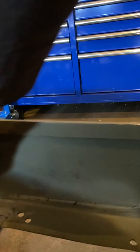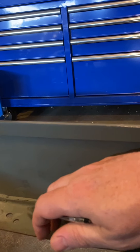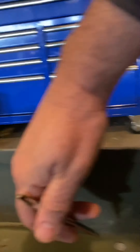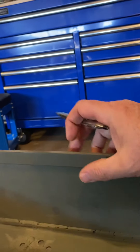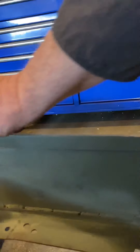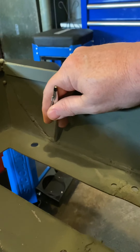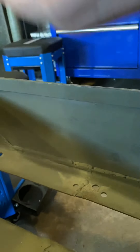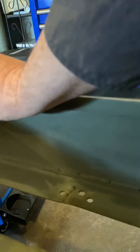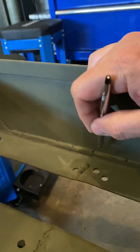I could just fill this in to make it look a little bit better and be done with it. What I think happened is this panel here was cut out and replaced — someone made a new panel and stuck it in there. I think what happened down here is they just moved the remaining original piece outward and shoved it inside between, because these are made of two panels, and just welded it.